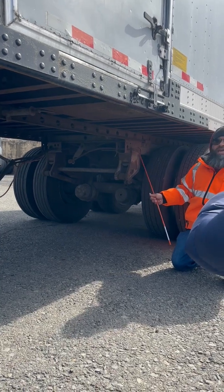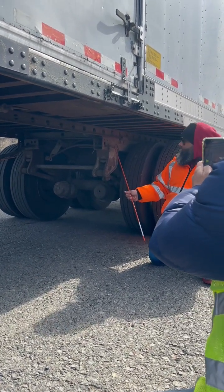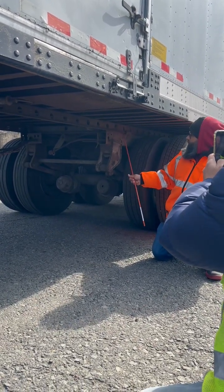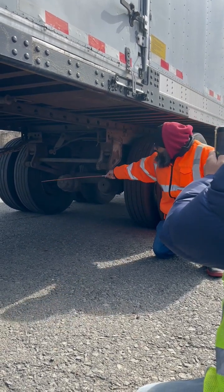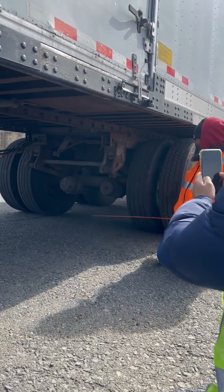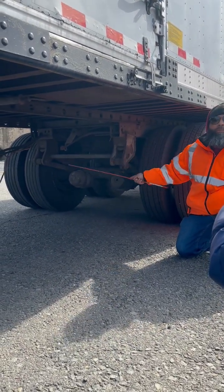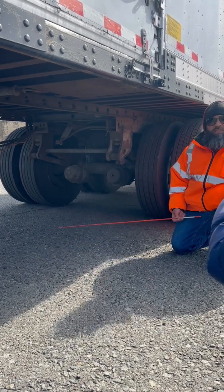My sliding tandem release handle, properly mounted, not cracked, broken, or damaged. It's in a locked position. I can confirm that because I can see the pins through the windows. My torque bar, my torsion bar, and my stabilizer, properly mounted, not cracked, broken, or damaged. Has all of its nuts and bolts.